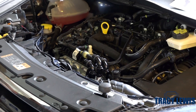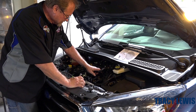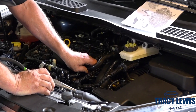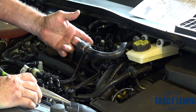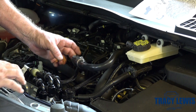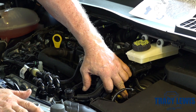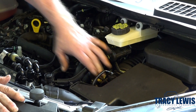Now we're going to go over each of these connections on the PCV system. First we have our clean or fresh side. As you can see, there's a flow sensor inline on this — it's actually a MAP sensor that measures suction or pressure. We're going to retain this stock line here. We'll have a fitting that goes into it, and that's going to be one of the outlets — the in-boost evacuation suction outlet to the can, which will have a check valve inline. We're then going to draw our clean, fresh, filtered air just past the intake air temp sensor in the main intake pipe coming off the air filter box.